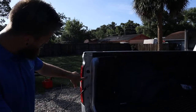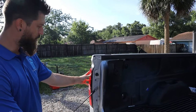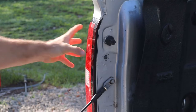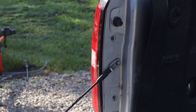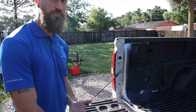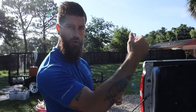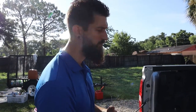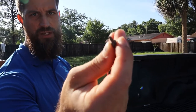The first step is to take out the two screws holding on my brake lights, reverse lights, and running light housing - we're taking this whole housing out. Then we're going to expose the reverse light wire, which is what we'll use to get power to the reverse camera. You want to use the reverse light wire because once you put your truck into reverse, that's what powers the light and will also power the camera - so it's only on when you're in reverse.